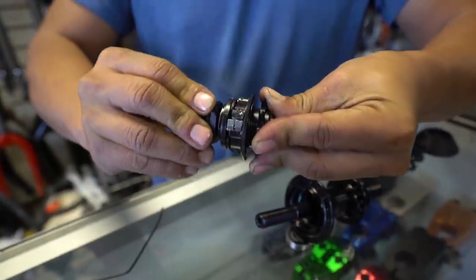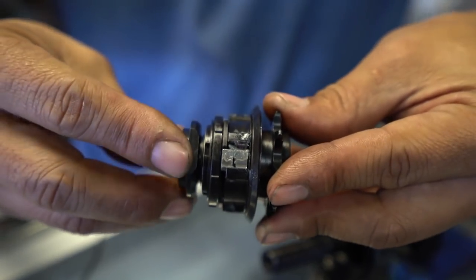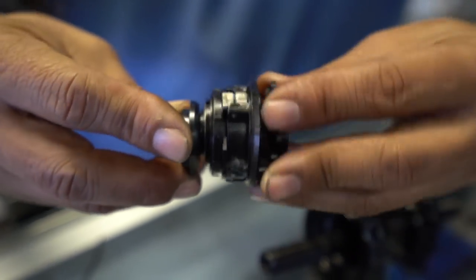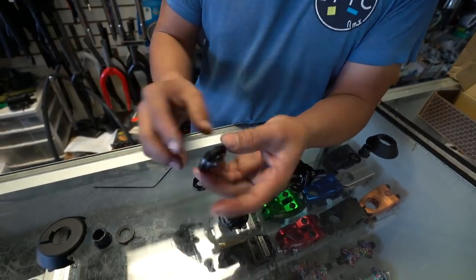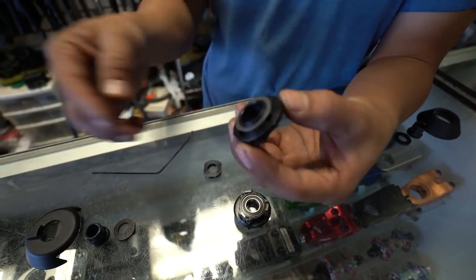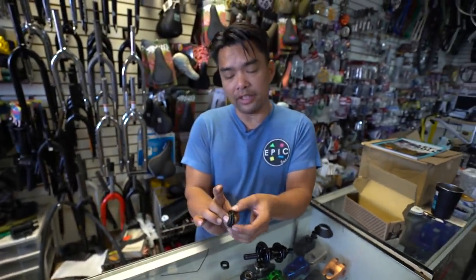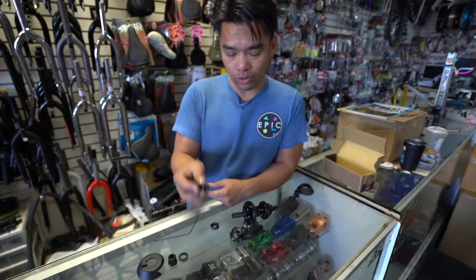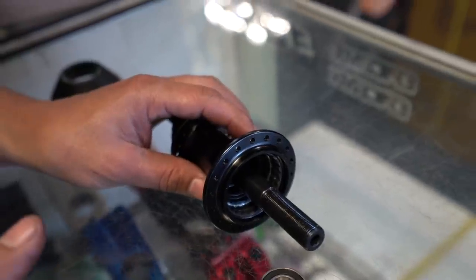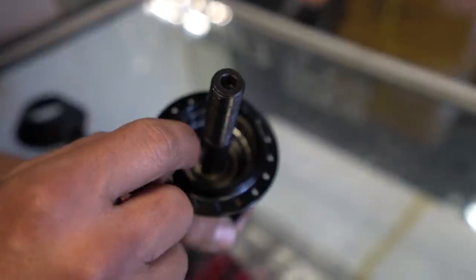See that? If this thing is just loose — look — I've loosened this up so it doesn't engage. It has to be pushed well together for it to engage. Ease off the pressure on my hand and it doesn't engage. Push it together, it engages. That's because inside this crazy planetary system, there are springs inside and all these little components that are preloaded to work with just the right amount of pressure for everything to work. So I'm going to reassemble this thing, step by step, to show you guys. Put the hub bearing into the body. The clutch goes in this way.